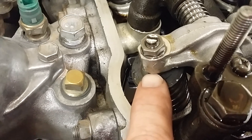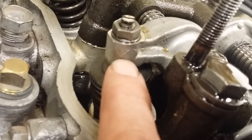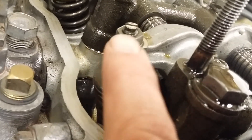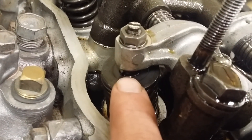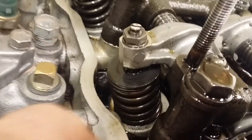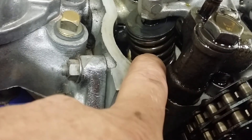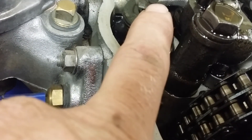What you're doing is — that stem in here is the rocker tip. What you're adjusting is the lash: the gap between the rocker tip, which you can't really see — it's under here, it's a hard steel. It's actually the other end of this piece, and it's touching or has a slight gap with the valve stem tip. Your valve is down in your head. This is your valve spring, and what the valve spring does is keep tension on that valve so it doesn't slap around, and also keeps it tight when it's not being depressed.